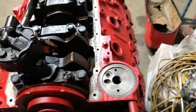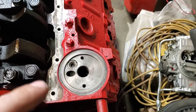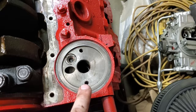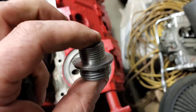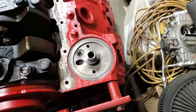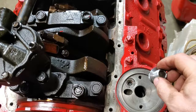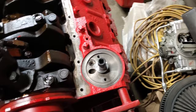When we were doing the oil cooler delete last time, we plugged the two holes after taking out the oil cooler hoses, then removed the pressure valve that was inside there. The last final step is getting one of these — it is the oil filter adapter where your oil filter threads on. That is GM part number 3853870; they can order that in for you, it's less than 20 bucks. You just thread it in with a half-inch Allen wrench and you're good to go.